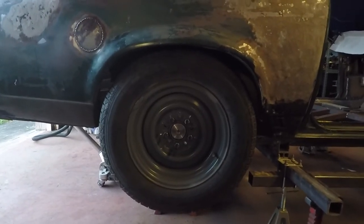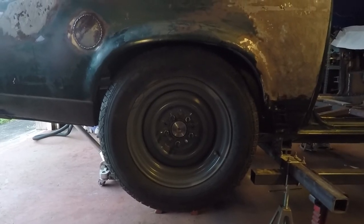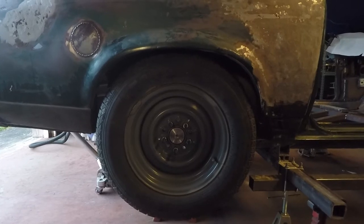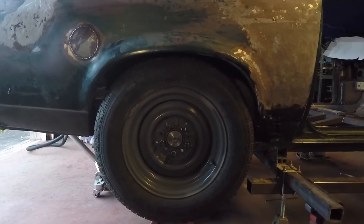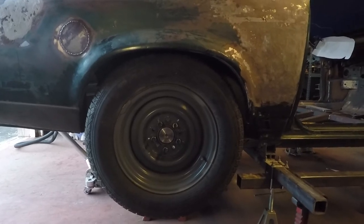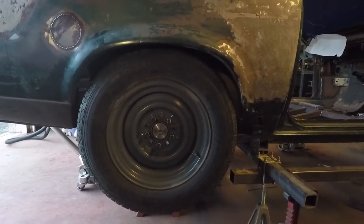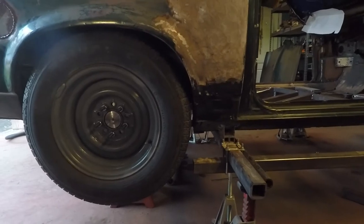We've stepped forward a little bit. We've got the axles in, the rear differential cover on, the C-clips in, everything bolted up so the rear end is done. We've got about two quarts of fluid in it, waiting for more to come in tomorrow. The wheels roll now without hitting anything. I think that is about the biggest tire diameter you can put on there — that's a 235-60R15. But it sits exactly how we wanted it, so that is basically at right height. I'm happy that we've got basically equal spacing front and rear. And we have the front suspension.